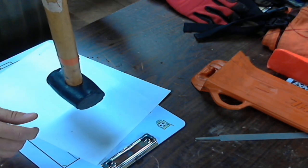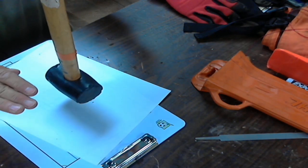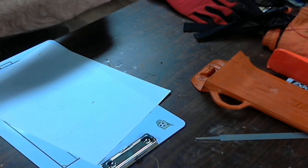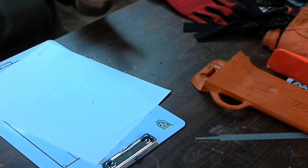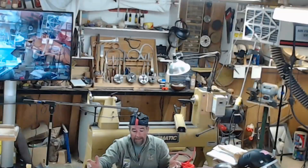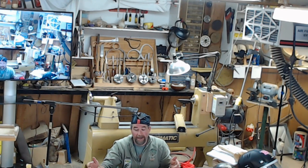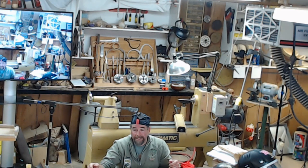And then I can go to my lowering device and basically lower it down and take pieces as I'm lowering it, and then drop it some more, just keep cutting to where I can handle it. That's my least favorite cut to make because I'm right there with it. It's just going to keep standing up, and it's more dangerous because you don't know where it's going to go after that. At any time it can slide out, at any time the branch that it's pinching can break out, and you just got to be ready to run.